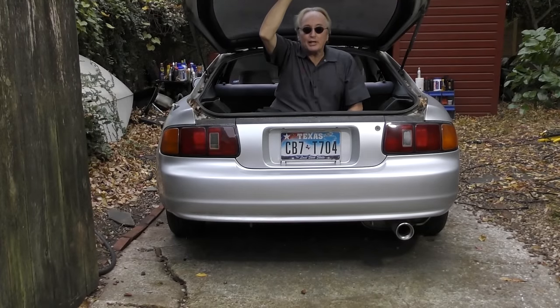And here's some bonus questions and answers. Willy Wonka's a Fool says, 2013 Toyota Camry, 4-cylinder, I lose power once it gets above 4,500 revolutions. I had a mechanic look at it. He can't figure it out. It's got three codes, P0717, P1603, and P1605 for rough idling, engine stall, and input speed sensor.